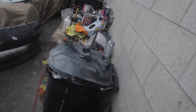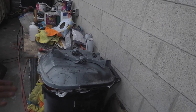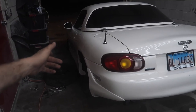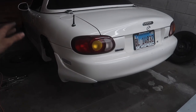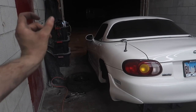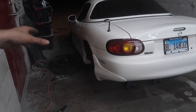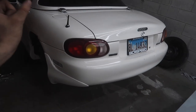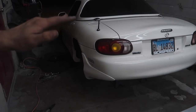Both control arms are out, cut, and welded to the exact length we need. I threw a quick layer of whatever paint I could find — I'd love to do single stage black but I need to get this thing running and driving right now. We're going to wait for those to dry, throw them in, and we should be sitting at about 12 and a half degrees of camber all the way around. Even though the front is supposed to be around negative 10, I adjusted the camber bolts — that's where we got the extra two and a half degrees. Both sides are now reassembled.